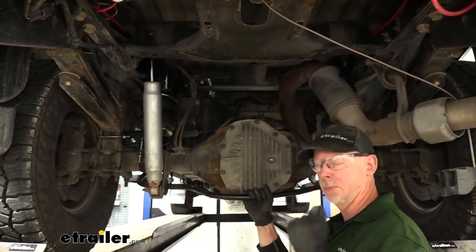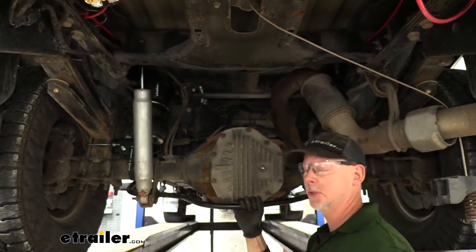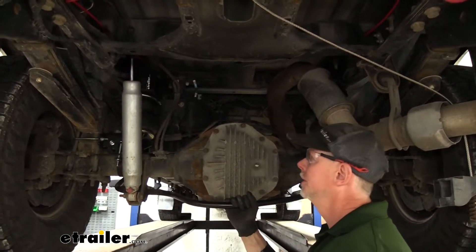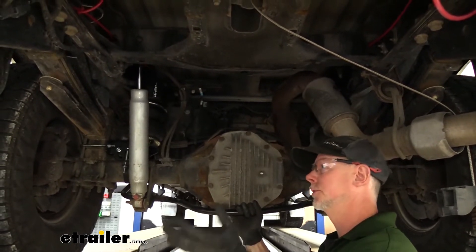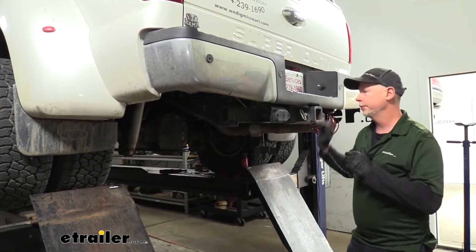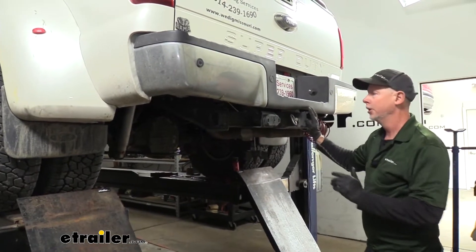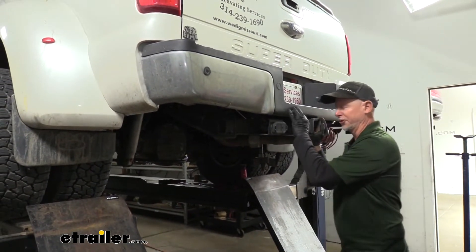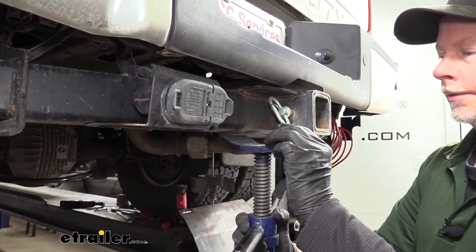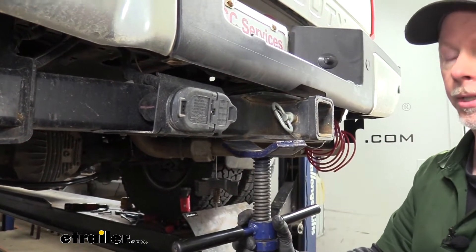The brackets are all designed for the truck frame — no drilling required, just patience and a few fasteners. You'll also need a couple of things to help lift the body off the truck and allow the suspension to move. To start our install, we need to remove the spare tire since we'll be spending a lot of time underneath the vehicle. You also want a way to push the vehicle frame up off the suspension for more working room — I'm using a pole jack on my lift, but at home you can use jacks and jack stands.